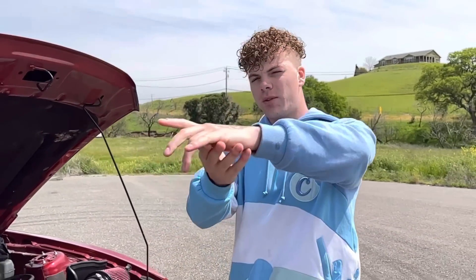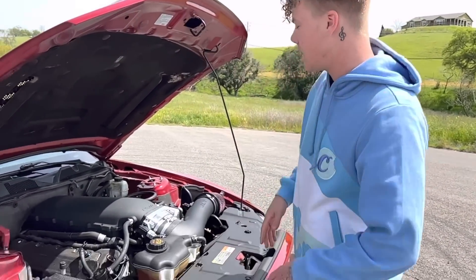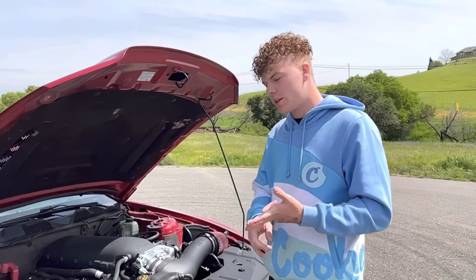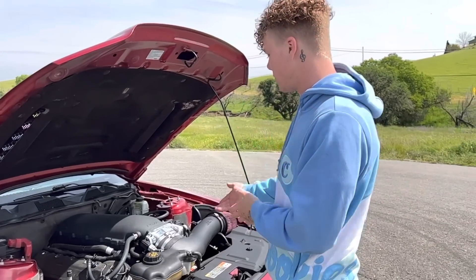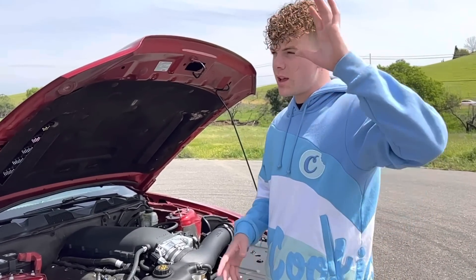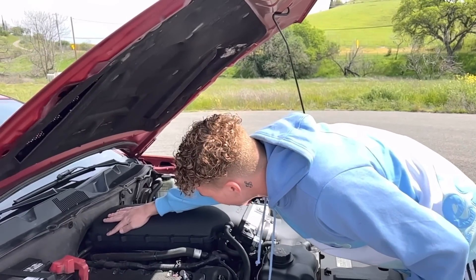We're going to get some drivability videos and pull videos for y'all. I can do a 60-to-130 on the Draggy. This thing does heat soak a little bit, but it's not that bad from what I've seen — my intake temperatures are up and down so I haven't been able to fully test it. Overall I haven't had too many issues. The main things you're going to need are the harness, your cold air intake, and the throttle body. I'd recommend going with the 69-millimeter VMP throttle body. The other style with the wide-open single opening makes more power, but the drivability is going to be terrible — that's the only real issue with those.